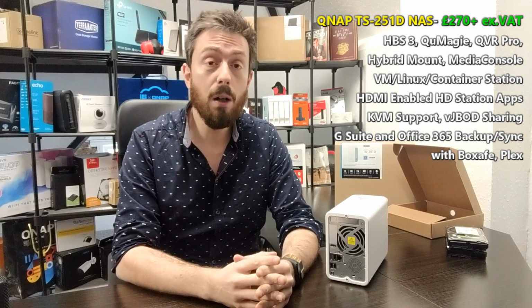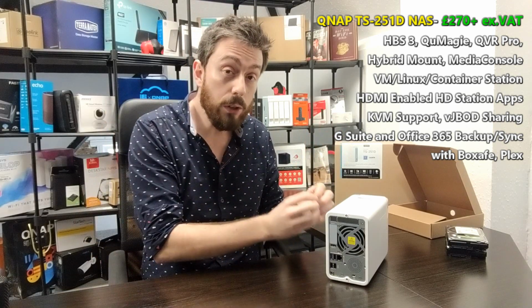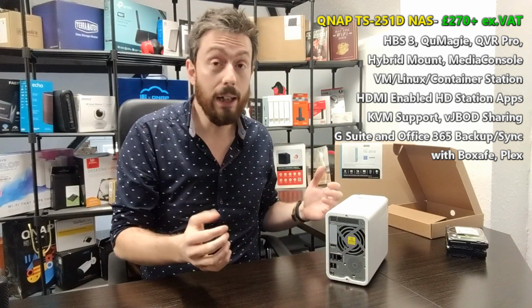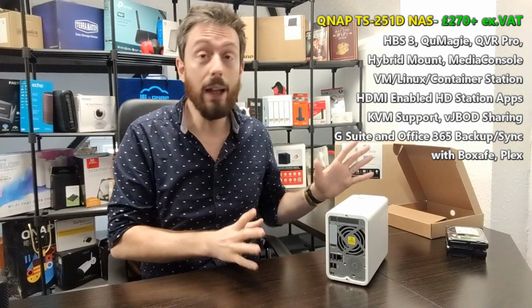I talk about the surveillance application. The surveillance applications on this are Surveillance Station and QVR Pro. There are 4 licenses included for 4 IP cameras on Surveillance Station and 8 camera licenses on QVR Pro. You can even use a simple USB camera, connect it to one of those ports, and add that camera as one of your supported surveillance cameras. It's really that straightforward, and you can use IP cameras or even your mobile phone as a camera if you so choose, all of which saving to the machine, accessible via any of the connected devices that you've given permission to.